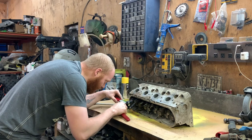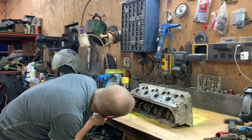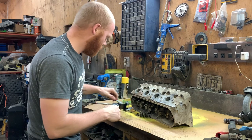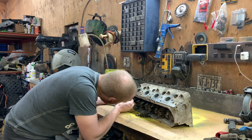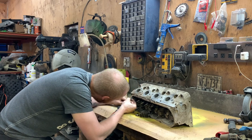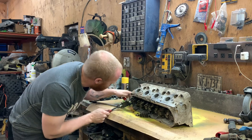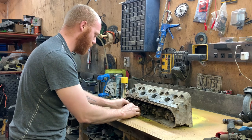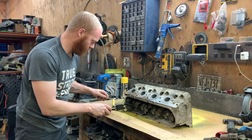I have the old style that screws down. Oh, they're horrible. I've had so many fly across the room. It screws into where the rocker screws in, right? Well, there's a lever style like that one, too. They work really well. I saw somebody made one. Sloppy makes them, or made his own with a bolt and a wrench or something. Yeah, I've seen it made with a wrench. You can drill a hole in a wrench, the right size wrench. You need some serious drill bit.